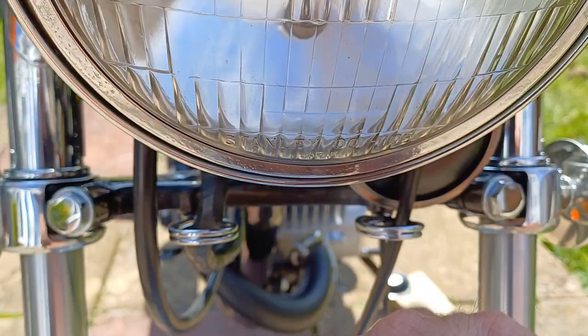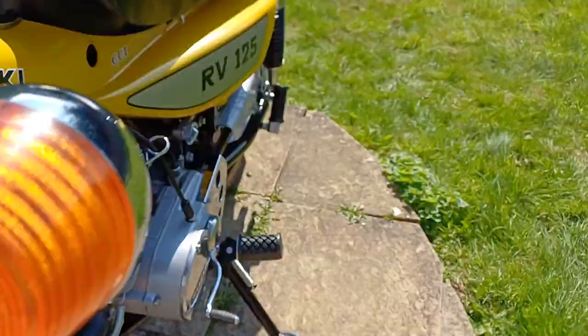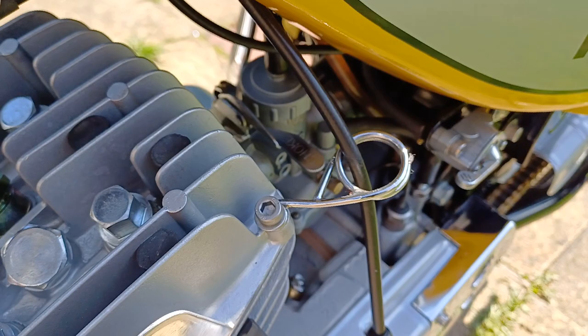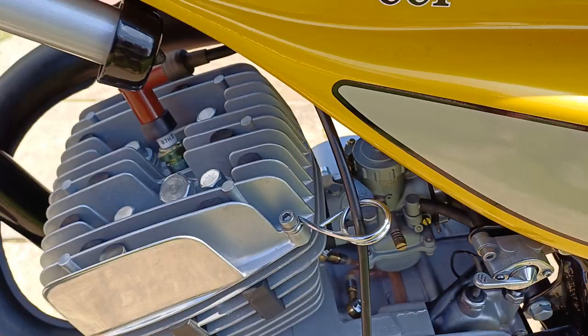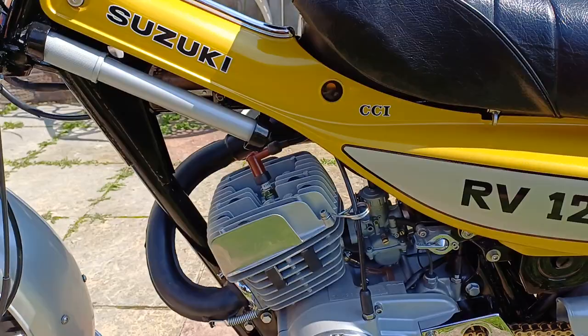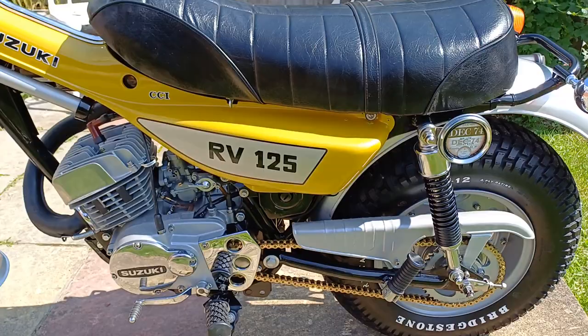I just made these metal cable ties and then had them chromed. Sort of look good, hold everything in place. I also did a third one just down on the head there — just heavy gauge metal in a vise, bent around something and then brazed up to stop them unraveling, and off to the chromers. New old stock footpegs. So that's it — my last RV125 restoration.